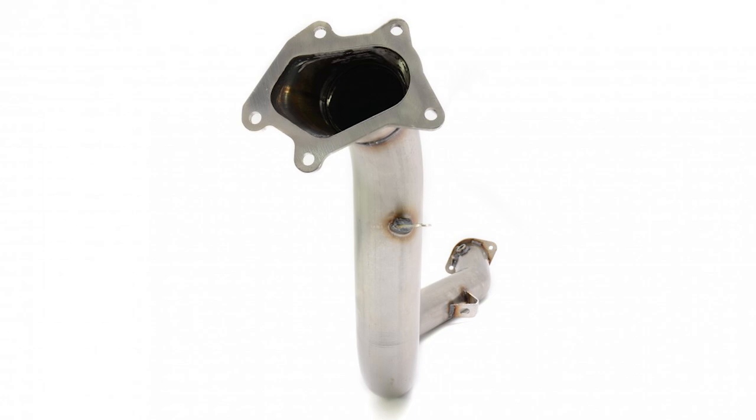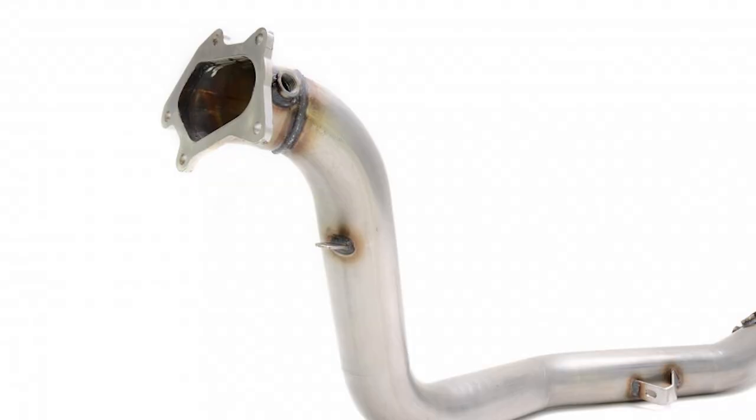The unusual one is that because each tube only sees pulses from two cylinders, you can't put an O2 sensor in just one of those pipes because you'd only be looking at half the engine. The twin scroll cars actually move the front O2 sensor behind the turbo into the bellmouth, so you have to move that O2 sensor back. If you do all of that — replace all the exhaust and put on the turbo — that's everything it takes.